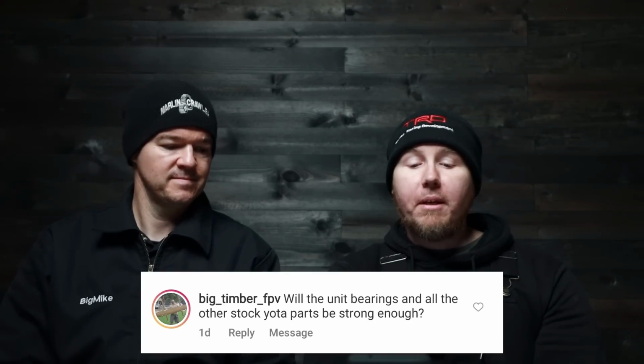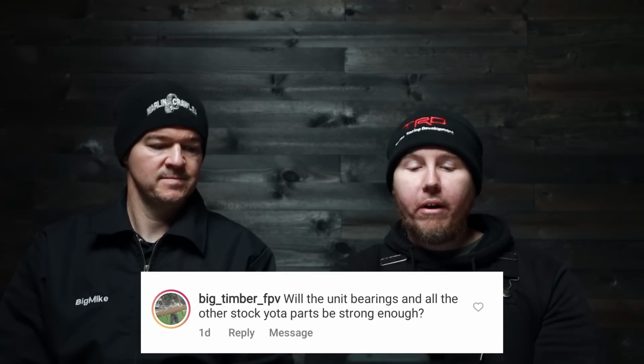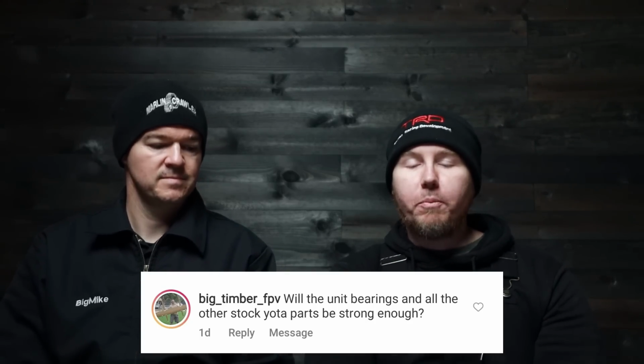Next question from Big Timber FPV. Will the unibearings and all the other stock Yota parts be strong enough? So in my experience, I've had zero problems. 40-inch tires. These are big. My tire is 148 pounds per tire, wheel and tire. And I now have over 40,000 miles of daily driving and rock crawling across six states, driving with the same factory unibearing. I've never had a single problem. I don't carry a spare. It's never let me down.